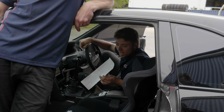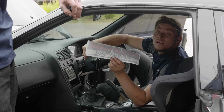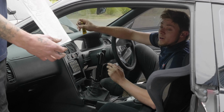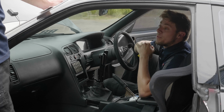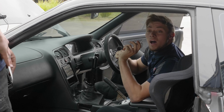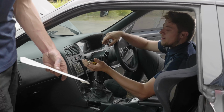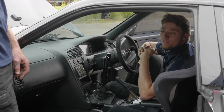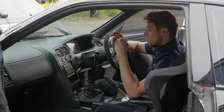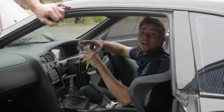Okay, the clutch. In the car here, you've got the engine and the gearbox, and between them is the clutch. The Direct Clutch Services twin plate clutch was sent back to them and refurbished. They rebuttoned it and gave it back to us with a bit more clamp pressure. I think we went up from about 2,800 pounds of clamp pressure to 3,100. It's been refurbished and rebuttoned so it can handle a little more power. It was taking it just fine, but this makes it more reliable, so we won't have to worry about it.